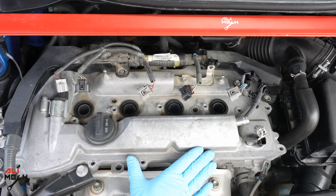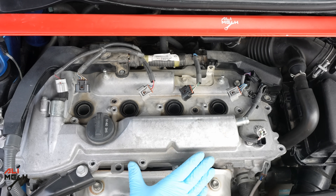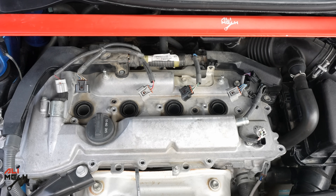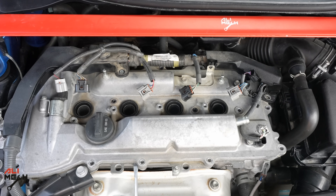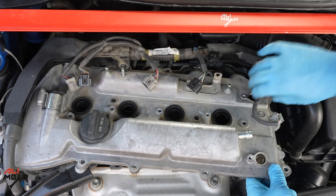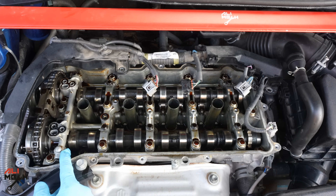All the bolts are removed. Now we're going to lift the cover — most of the time the cover is stuck even though we removed the bolts, so you'll need a flat screwdriver to lift it up. You have to be careful because the manufacturer made specific places for lifting; we can see them here and here. Because I had to slide out the cover, the camshaft sensors were in the way, so I had to remove them and then slide it out. The cover is now removed and the filter basket is located there.